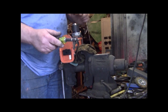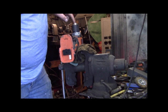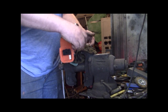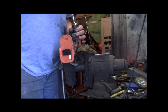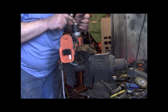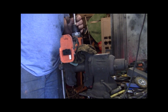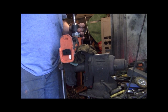You're going to need a screwdriver or an Allen wrench, and a lot of them have a Torx bit down in here, you know, the star bit. But you reach down in here. I prefer a vise. Get yourself some old rags and support your drill. Now the screw that's down in the center of your chuck is going to be left hand, so you turn it the opposite way you'd normally turn a screw. So pretend like you're going to tighten it up.